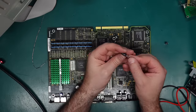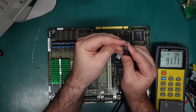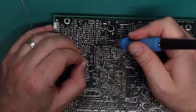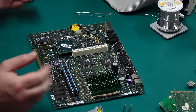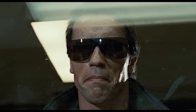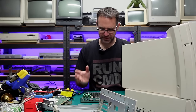Here's a nice Rubicon 100µF 25V 105-degree-rated cap. It reads 93.7µF with an ESR of 0.4 ohms — within the 20% tolerance, and that's much better than the old one. While I've got this all out I might dust off this board, get a couple of photos, and submit them to the RetroWeb just in case nobody's done that yet for these machines.